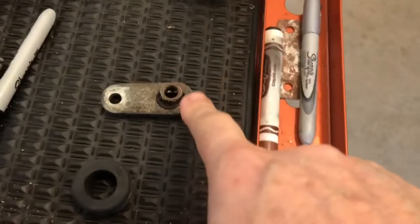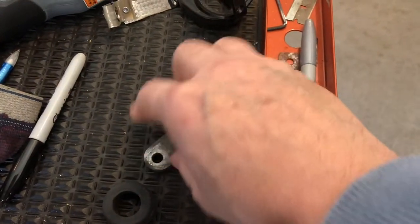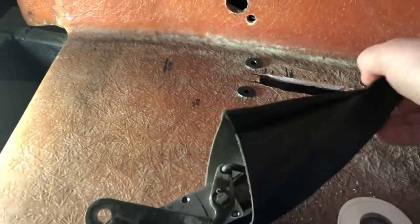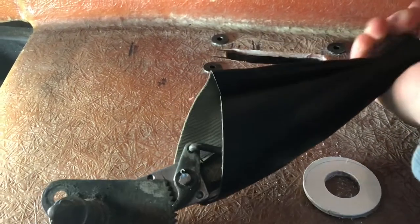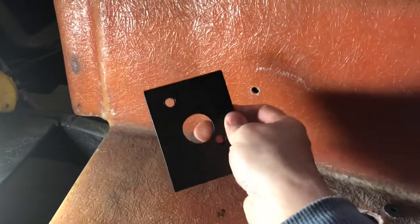It's pretty simple how this works. The cam bolts on — you crank the handle, it pulls the brake cables, you put a clevis pin here. Very simple. I test fitted it and the locking cam stuck out a little bit more than needed, so I ground it down a bit. I also fabricated a backing plate at work — just a nice eighth-inch panel with a hole saw and mounting holes on the back so it doesn't just mount into fiberglass.